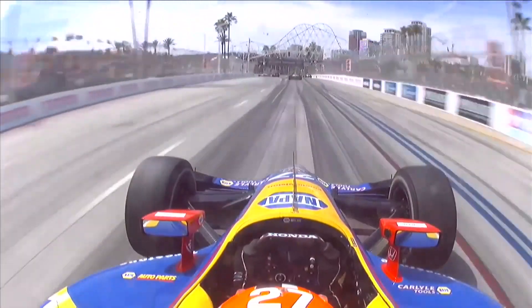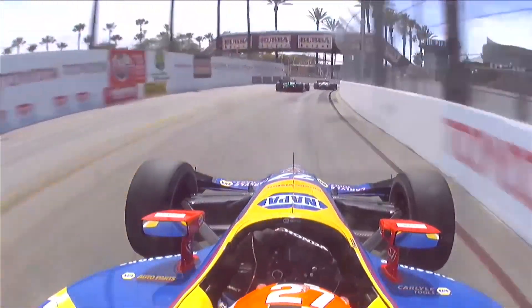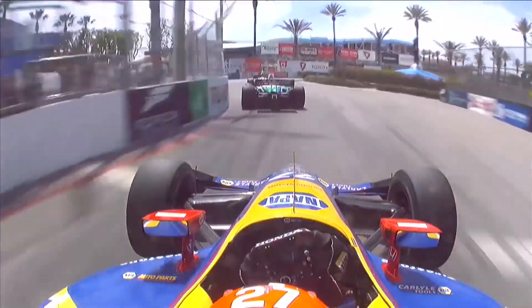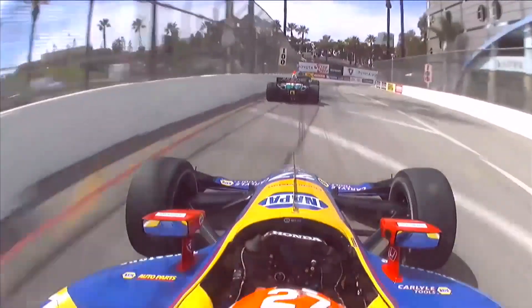There'll be times when you might have your damping front to rear out of phase, and then the car is very pitchy — and that's probably one of the biggest things for what will allow the driver to go quick. We might find damping setups that actually have less grip, but the platform is more consistent, and if the car is not pitching they'll tend to have more confidence in the car and extract speed from it.